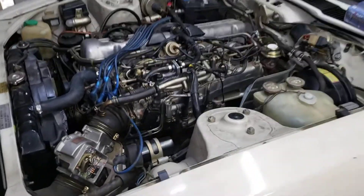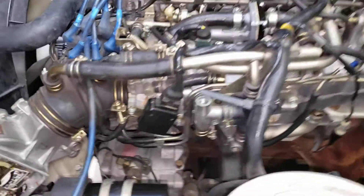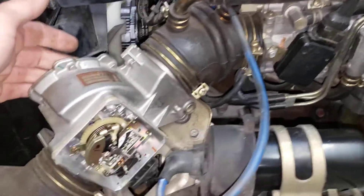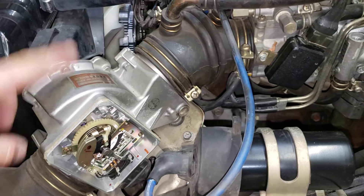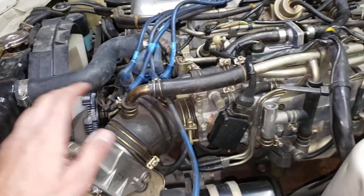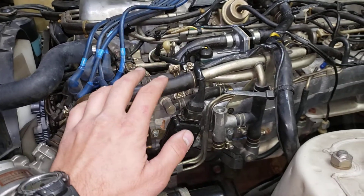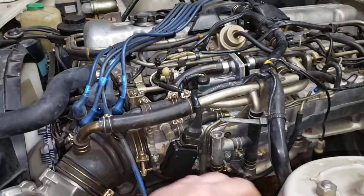Here's an update on the 280. I did a previous video about a bad cold start with backfiring and a poor idle, and ended up narrowing it down to the airflow meter. I had to do a lot of stuff to get there — I had to set timing, reset the throttle position sensor. It looked like people had been chasing this issue for a while and messing everything else up in the process.